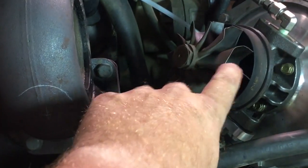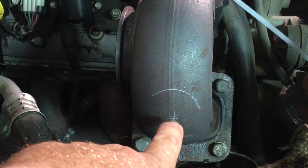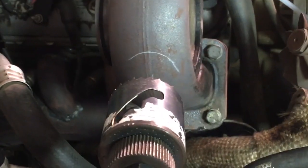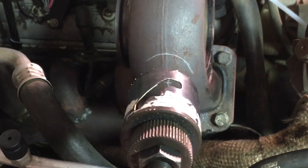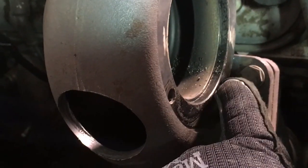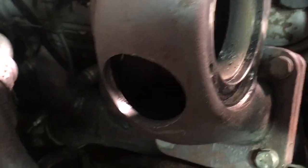So I've got the turbo center section pulled out of the exhaust housing. I've got marked where I'm gonna drill my hole here. I got the downpipe taken off. So I'm going to use this drill and hole saw and knock out a hole in the exhaust housing for the wastegate. So I got that hole cut in the turbo exhaust housing and I see there's a bunch of chips and stuff in there. So I'm gonna pull that turbo housing off the manifold and clean it all out.